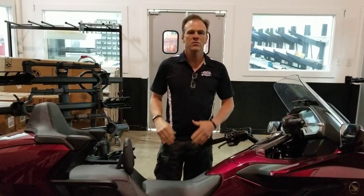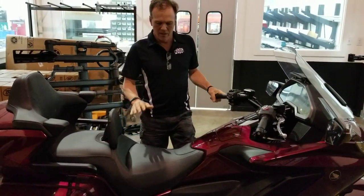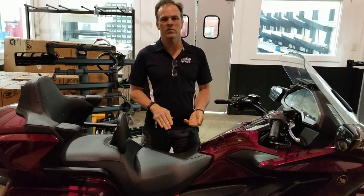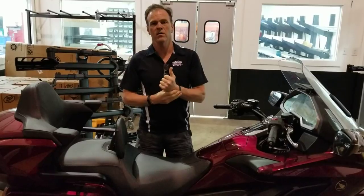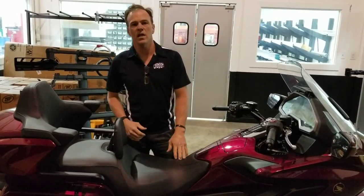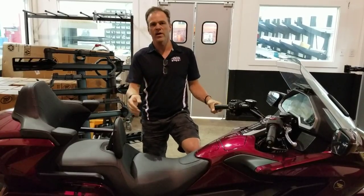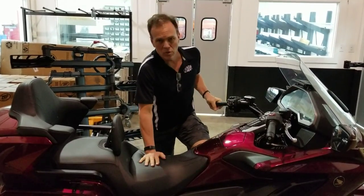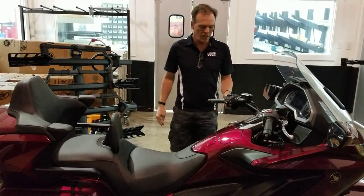You can check out his company versus buying a whole new saddle — you can have yours modified. Here's bad news for 2018 Honda Goldwing owners: for the 2018 Honda Goldwing, the nature and shape of the seat does not allow any foam to be removed. In other words, you can't get the rider any closer to the ground. That came from a conversation I had with John at Wingsoft, who has had the saddles all torn apart and inspected them, trying everything he could to bring the rider closer to the ground. So for 2018, there is no joy to be found on this bike for shorter inseam riders.